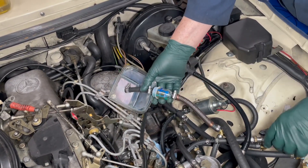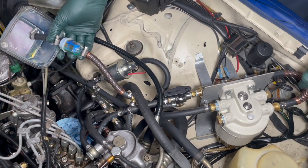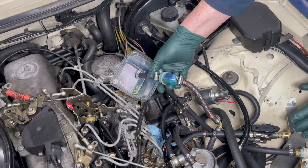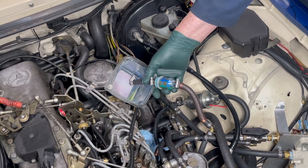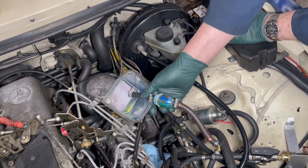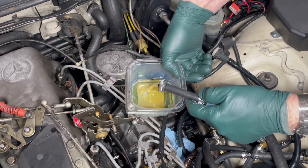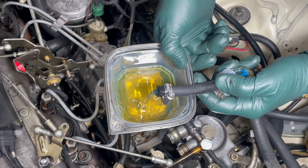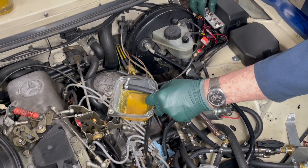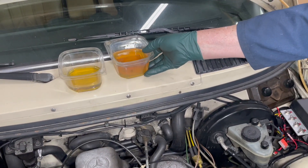Now I'm going to take and turn the valve. That's going to bring our fuel from our veggie tank up through the veggie filter and through here and take it into this line. There are two reasons I'm doing this procedure: one is to test the valves and the plumbing, and the other is to purge both systems before I try to start the engine. If you have a bunch of air in all these hoses, you're going to have a heck of a time getting this engine to run. I'm going to turn on the pump in the trunk. Here it comes — that's coming all the way from the trunk. That's vegetable oil — that's Mazzola. Top grade; I use nothing but the best. You can see how thick that fuel is, and that's the reason we use a boost heater. I'll turn the pump off. We have diesel and we have vegetable.